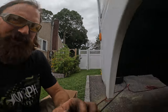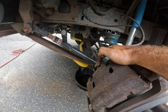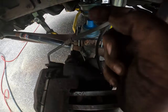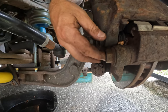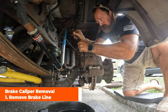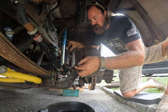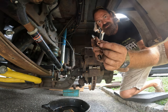We're over here at the front driver's tire. Here is the caliper — we gotta take this off. Here's the brake line — this is a 14mm bolt. I already did the passenger side so this is just gonna be popping this off. There shouldn't be much fluid coming out, but I've got my drain bucket there to catch anything. There are two big bolts, one up here and one right here — just pop these off and we can pull the whole assembly out. Make sure you save both washers.